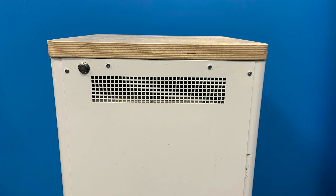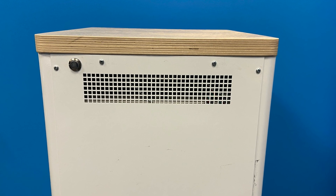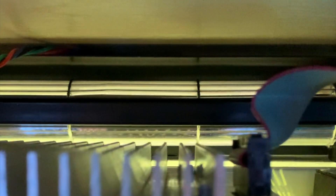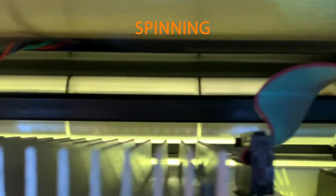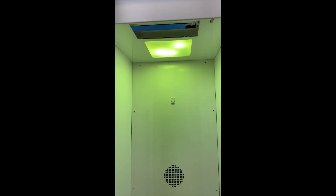The second area to troubleshoot is the cross-flow fan. Go to the back of the unit and look in through the top grate. Do you see the fan spinning? Do you feel air coming out of the back of the grate? If not, we might have a cross-flow fan problem. Check inside the unit — you can remove your carbon filter to see if your fan is spinning or not.